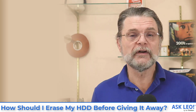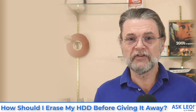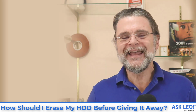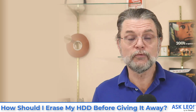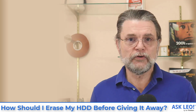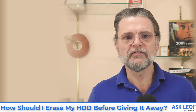Now, I'm not aware of any free ones right now. There's one called Parted Magic that seems to get referenced a lot for this specific task. It includes other tools, of course, but it does include this ATA secure erase. That is what SSDs will use to erase all the data. But the important takeaway here is not to use a tool like DBan, but rather use an SSD-specific tool to erase the information from your SSD.